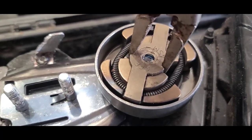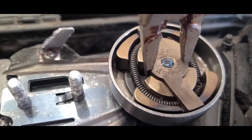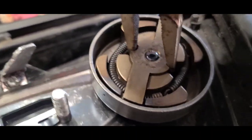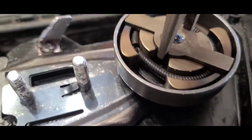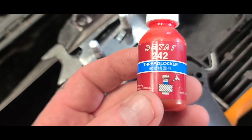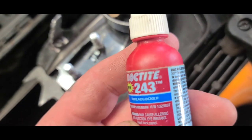I don't have the right — well, it's right, it's for high temp and it's thread locker, but it's not name brand stuff and it's blue. Now I'm going to get this as tight as I can, hold it, and then tap it tight with a screwdriver. If you don't have the special socket, that's what you're going to have to do — pull it tight as you can get it, then tap it tight with your screwdriver. I just found what I should have used — I might put some of that on there too.